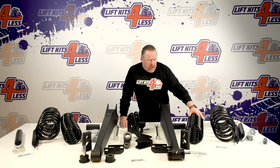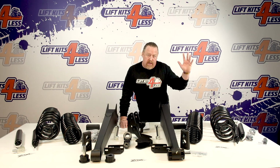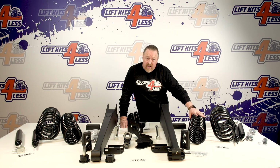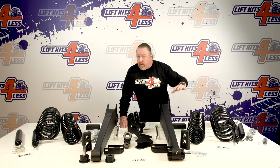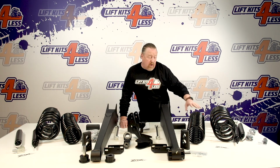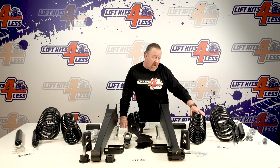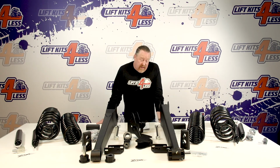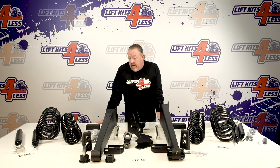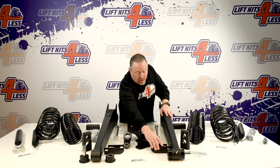absorbs that. So in terms of ride quality, if you have the opportunity to buy a dual rate coil spring, that's best value. The other is what's called linear. It has one rate, and they try to middle that, you know, high speed bumps, low speed bumps, big bumps. So obviously you got dual rate front and rear, so just awesome. If this was for me, if you can find dual rate, go for it. This comes with the kit. It's an incredible value.